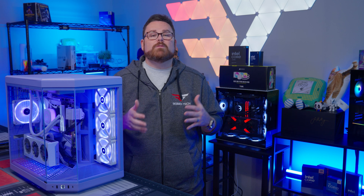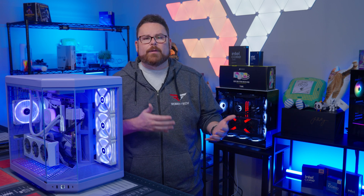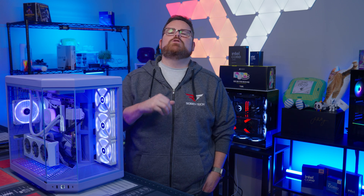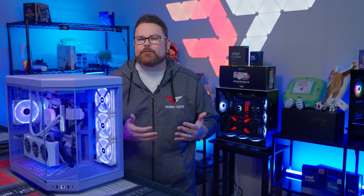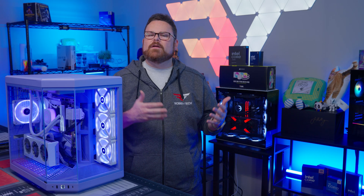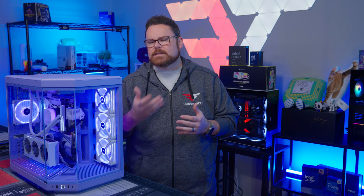Those limitations make more sense when we look at the actual mounting hardware. Rather than separating out screws and standoffs, Corsair worked them into the mounting brackets themselves, reducing the chance of losing parts during assembly. If you're installing the Titan on an Intel platform, we recommend doing it outside of the case — the bracket is a bit bendy. On AMD, be aware the brackets only allow hoses on either the left or right side of the pump head, so be mindful of chunky RAM sticks or you'll have to flip it around.